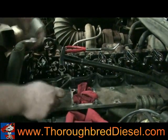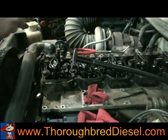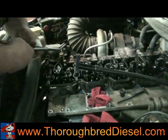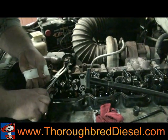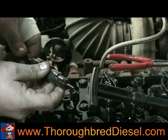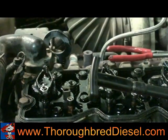When you go to take the injector out, what we use is a valve cover bolt — we screw that right into the top of the injector. Then we take a pair of bent needle nose pliers and just pop the injector straight up out. You can see the valve cover bolt sticking up out there — just pry up on it and the injector will pop right out. You want to always make sure it has the copper O-ring on the bottom. You do not want to put two copper O-rings on there. The new injectors always come with a new copper O-ring also.